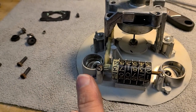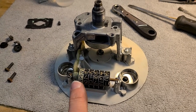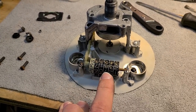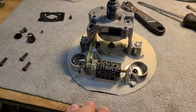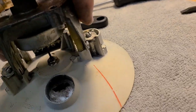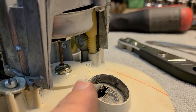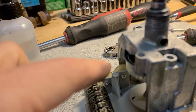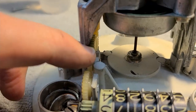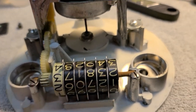Important warning: don't touch the odometer numbers or any paint on the dial - some of that paint can be perished and smearing it is nearly impossible to fix, requiring physical replacement of components rather than repainting. Back to the issue: hearing a click every certain number of rotations - the worm gear is skipping on the gear right next to it. Checked those gears and they seem to move freely.